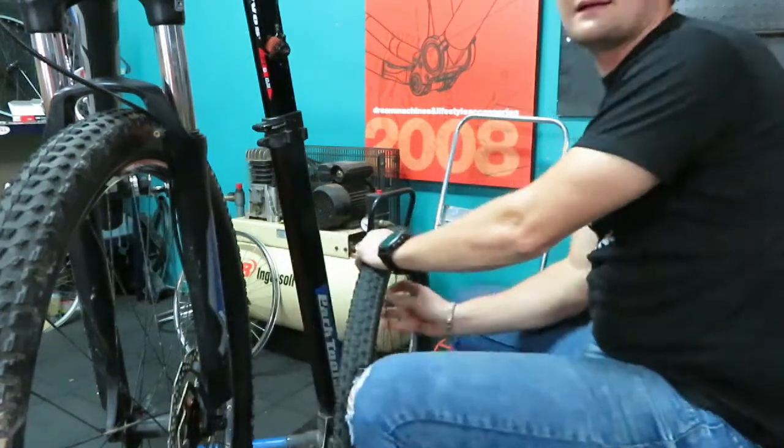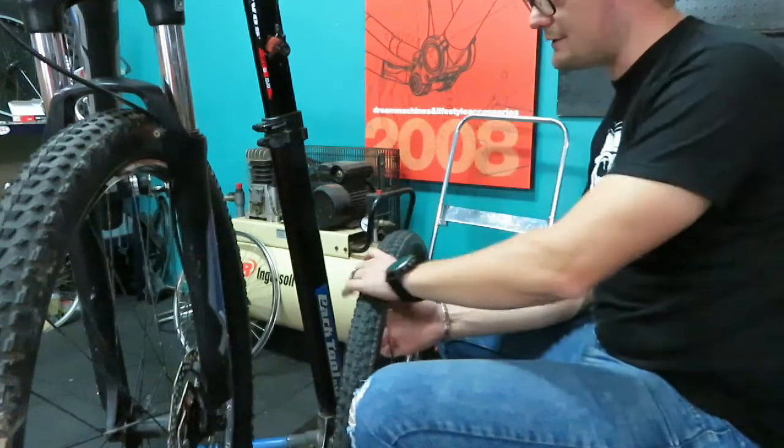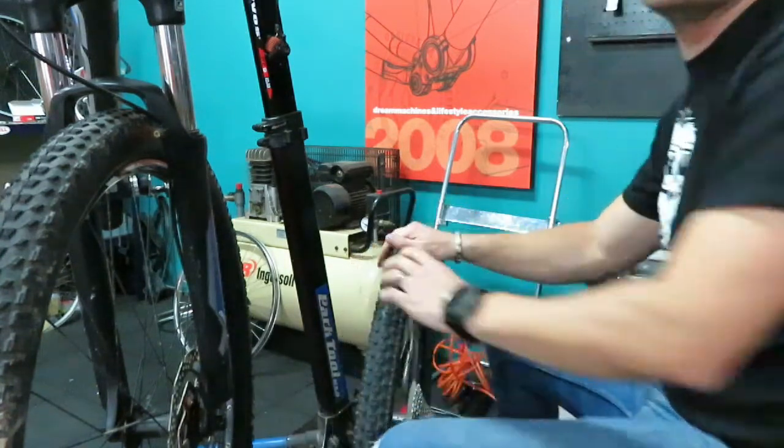We got lucky this time. Otherwise, just use the blue valve core tool and you should be good to go. That was a super easy install — you should be able to do a tubeless wheel with that. If you still struggle, send me a message or leave a comment below. What I usually do afterwards is make sure the tire is seated all the way around, put the wheel on the bike, then spin it on a stand so the sealant seals the whole thing. I promise you, you shouldn't have any problem from there.